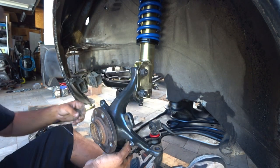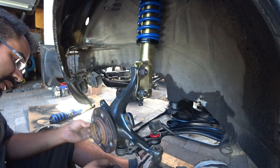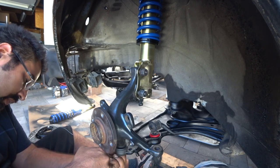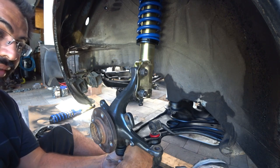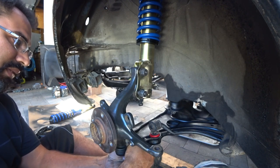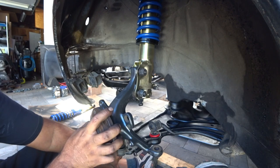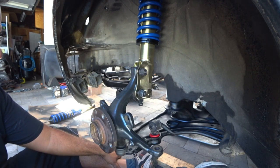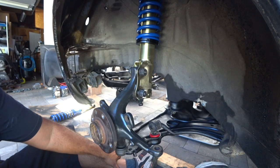Once you have those two on there, down below there's three bolts — I only have two for right now because I'm only getting this set up. The strut bushing I got on this car was only 20 bucks and it's a lot stiffer. If you guys are going to do some upgrades for suspension and performance on this car, definitely a good upgrade since the car doesn't weigh very much. This is only a mock-up for the moment, but that's how you install your front coilovers. It's so easy on a Mark II and a Mark III — probably the easiest suspension I've ever done in my life. I don't think any other car gets easier than this.